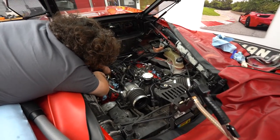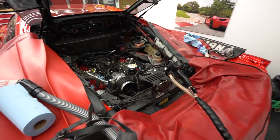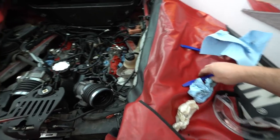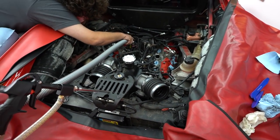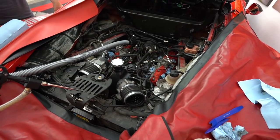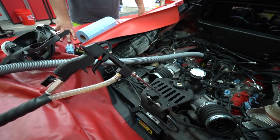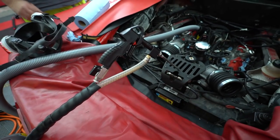I sent the pictures to Josh and he said to use a plastic tool and knock some of those big chunks off first — it'll be a lot better. So I took some trim tools and reached in there scraping off the big chunks, and holy crap, we got it way, way cleaner. That's actually the right way to do it: knock the big chunks off with a plastic tool first — definitely plastic, not metal — then blast. Also, doing quick bursts of less than one second seems to work best because holding it too long causes the media to back up in the tube.